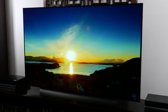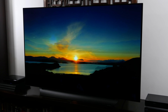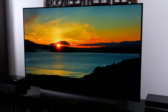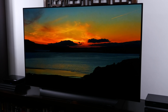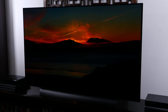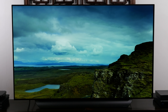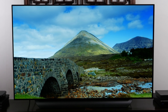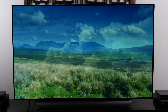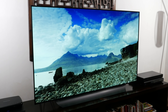In terms of picture quality — both out of the box and after calibration — really, really good for both SDR and HDR. In terms of actual performance with content, again a really impressive TV. Lovely picture, natural colours, very bright. It's more than bright enough for SDR content, and for HDR, obviously being an OLED it won't hit the peak measurements of an LCD television, but you can get around 900 nits on a 10% window and possibly up to 1,000 nits on a very small specular highlight. It can do this at a pixel level because it's self-emissive, so you've basically got 8 million dimming zones, giving much greater control in delivering the HDR experience. The absolute deep blacks really extend the dynamic range from black to peak white. You've got the deep blacks, very precise control and dynamic tone mapping as well — the result is a really impressive HDR performance, even though this TV isn't as bright as some LCD TVs available.